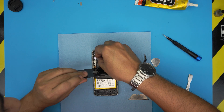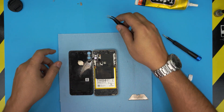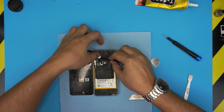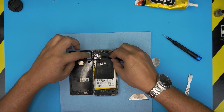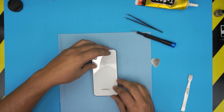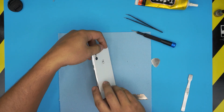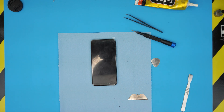Grab the contact for the touch ID and press it on top. Then put the bracket and screw for this one — grab it, bring it over, align it, set it down, and press on it. And there you go — that's how you upgrade or replace your screen for the Moto One XT-1941. If you have any questions or requests feel free to leave them in the video comments — I'll try to answer them as soon as I can. Thanks for watching and I'll see you in the next video.